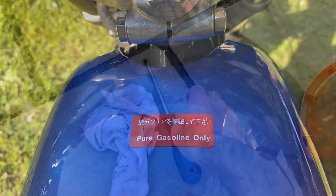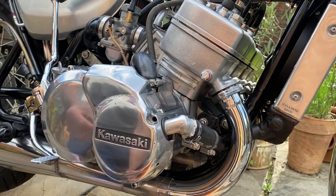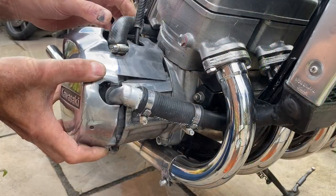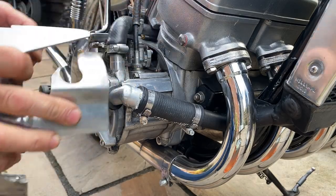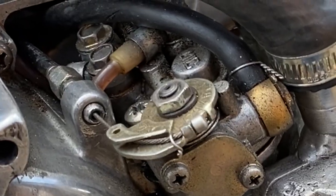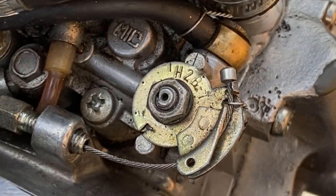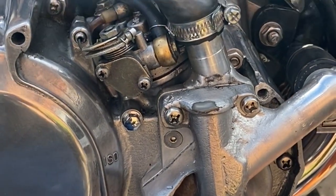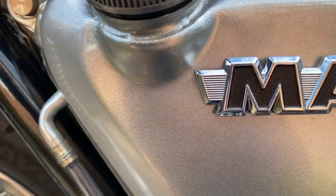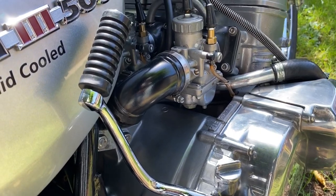The petrol tank holds pure petrol with no oil mixed. Oil is metered into the engine via a separate pump that once belonged to a Kawasaki H2B. The pump has four outlets so I can use one for each independent cylinder. The oil pump sits behind the water pump and is controlled by the throttle cable, so as you go faster more oil is injected and when you go slower less oil is injected — this hopefully reduces the amount of smoke. The two-stroke oil is held in a tank on the side of the frame with a nice little sight gauge at the back. The cap is from a GT500, made of aluminium and looks much nicer than the plastic Kawasaki one.